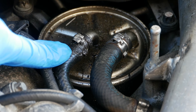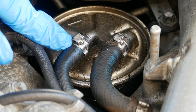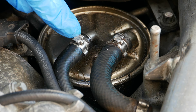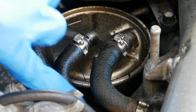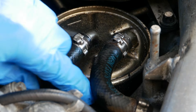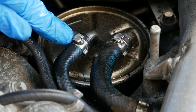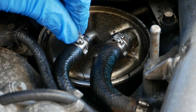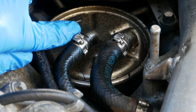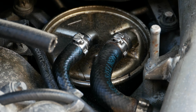I'm going to clean this up so I can have a better look and see what the problem might be. It looks like this hose clamp has been digging into the hose quite a lot, and maybe with movement the end of this hose has started to wear quite a bit. But the hose itself doesn't look in such bad condition and I can see there's a little bit of extra length on the hose here. What I'm proposing to do is undo that clamp — they can be reused if you're careful — then snip off the minimum amount necessary from the hose, maybe about 10 or 12 millimeters, and then push the hose back and reattach the clamp. If that doesn't work then I do have the option to fit a replacement length of hose.